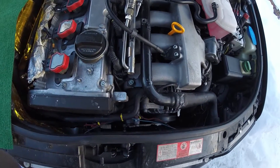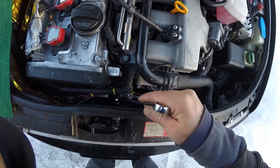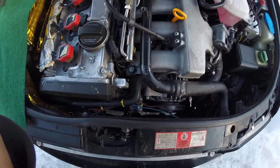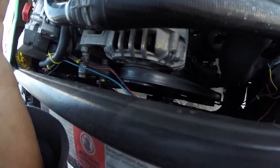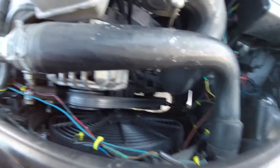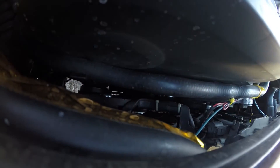Here's my workspace — not much room, which is a pain in the ass and that's an understatement. As I was rotating using the wrench, I noticed it's falling apart. The angle from the cap tells me it's a bad thing. Second, the imprinting on the belt tells me something is bad, and the shiny wear on the outside edge of that pulley also tells me something is not good.